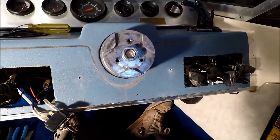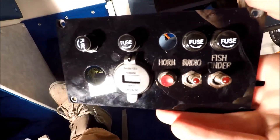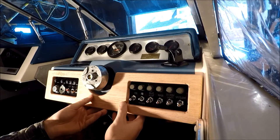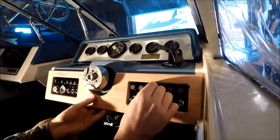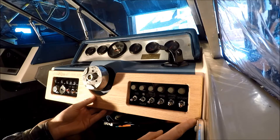Then we can fit the new plates in. I just made a new panel here for the fish finder and pre-assembled it so that I can connect all the wires on the back end. I just brought the wooden dashboard down from the shop and I'm fitting it here. I had to chisel away some in here because it was hitting this piece of fabric.